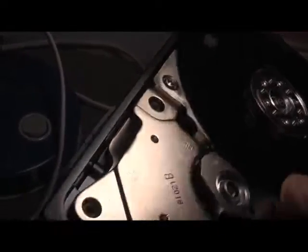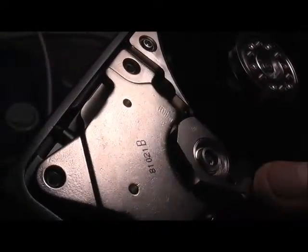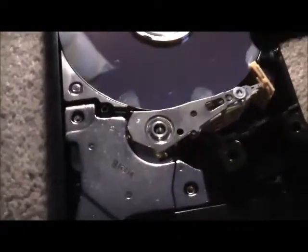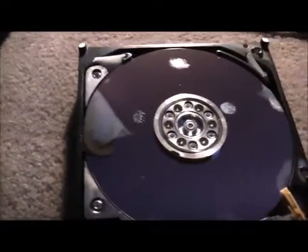This head assembly just pulls out once I get this magnet off. Very well made. Let's see why Western Digital drives are favoured. It's a shame it had so many bad sectors, but that's what you get when you use a green drive in NAS or RAID. I want to see how it behaves without the heads connected — will it actually start the motor up or not do anything at all? This is quite a heavy design — heavy and thick platters. I'd love to make a massager out of this. Very heavy — this will make a good massager for its weight.